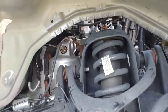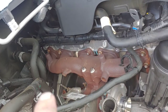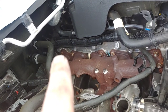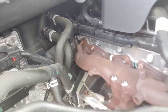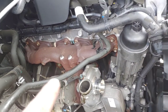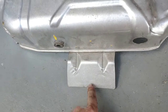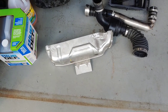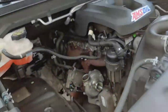This heat shield that was on here is kind of a pain. There's only three bolts holding it, and this back one is one of those bolts that's like way too long for the application and it's kind of hard to reach because there's a wiring harness right there. Take your time and you'll get it out. The heat shield itself has a piece that turns down underneath the turbo and gets in your way, but you can bend it a little bit and finagle it out.